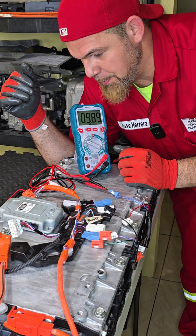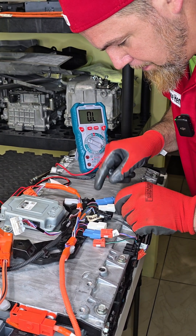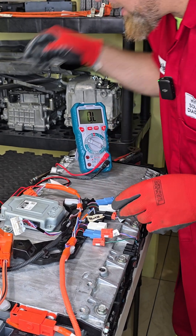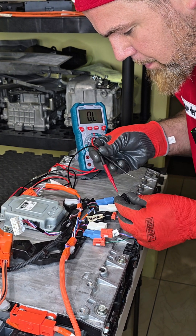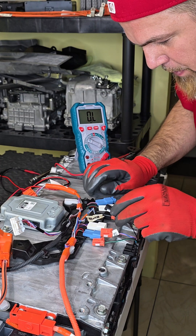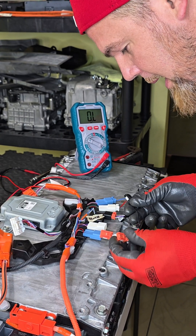It's clear now — someone was working on this battery and disconnected things the wrong way. This one goes here, this voltage connection goes to the voltage sensor. Checking pin number one and three again: nine kilo-ohms — the temperature sensor is fine. But it was connected into the voltage monitoring circuit. There's a huge problem here: these two connectors are exactly the same shape. I don't understand why they made these connections identical — it's so easy to confuse them.